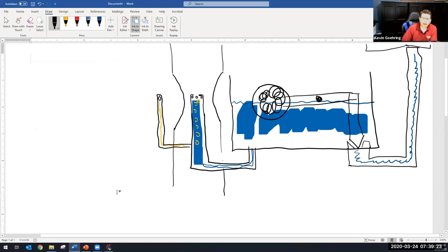What happens if this is blocked? We just go back to what the air bleed does. We're going to get larger globules of fuel coming out, which means less surface area, which means the fuel is not going to evaporate. So it would, in fact, be a rich mixture because the air is not going to surround it. We're going to end up getting too much fuel inside of the cylinder — it is a rich mixture at that point.